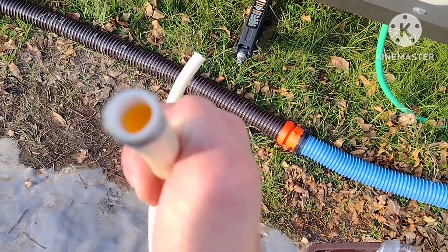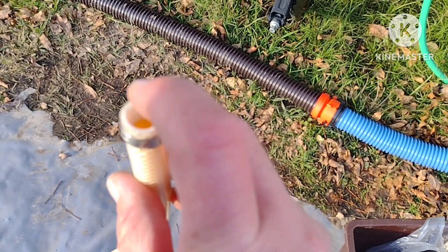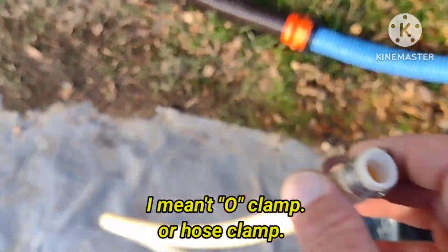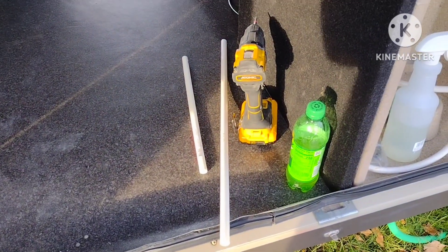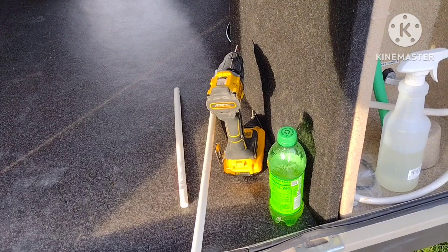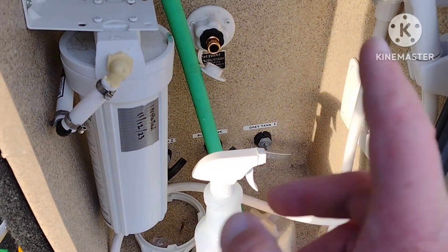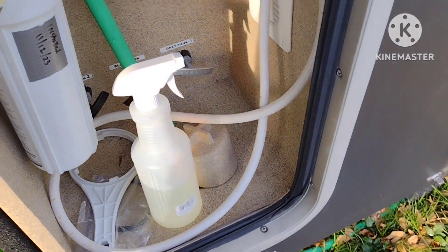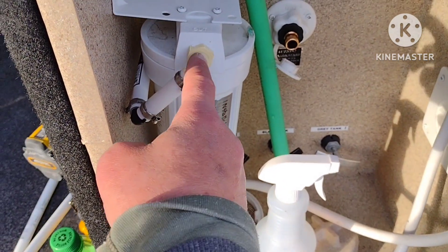The fitting just swims around in there — it's got so much room, it's not meant for this. These are for C-clamps. I would suggest anybody who has bought an RV to check the plumbing. If it's run with PEX, that's fine, but anywhere behind your water control panel where they've got braided hose connecting to PEX using PEX fittings, I would suggest changing it out.